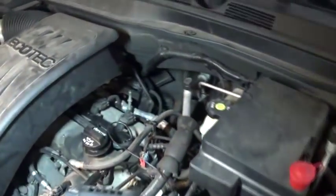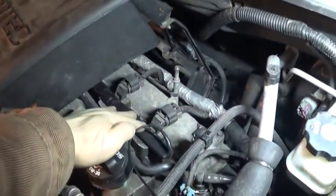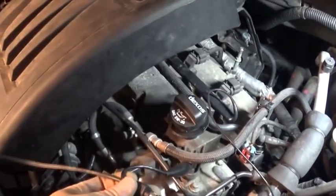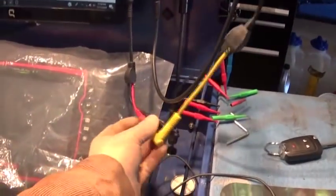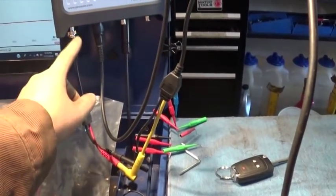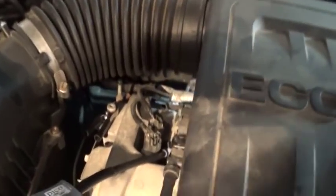Okay, here's the setup. I've got my probe on top of the coils, and it is connected to my Snap-on ignition cable. I got it hooked up to the ground, and then it's right here. I got a BNC connector, and that's my channel A. Channel B is going to be my sync. I just use my Pico pedal probe, and I just put it on the side of the coil here.